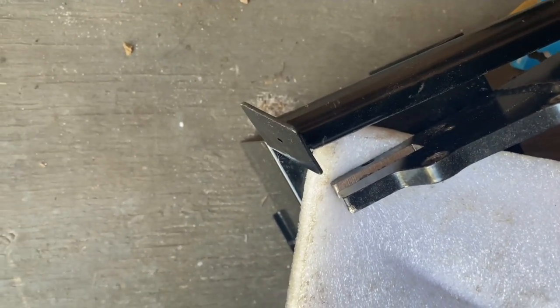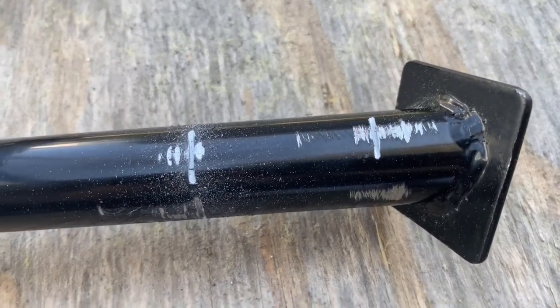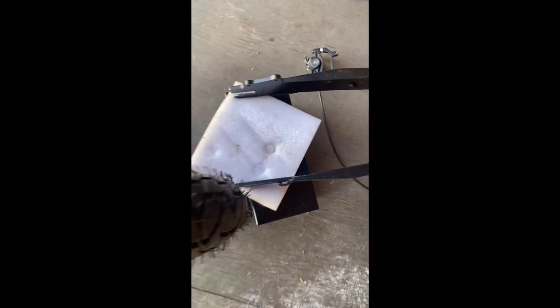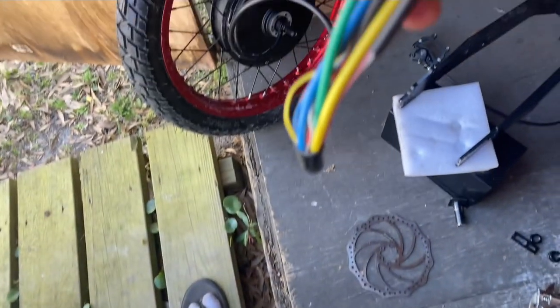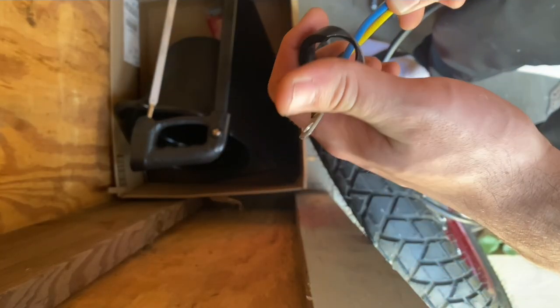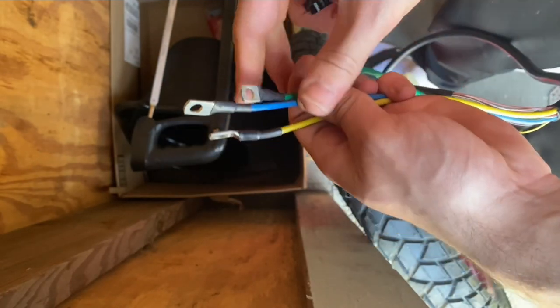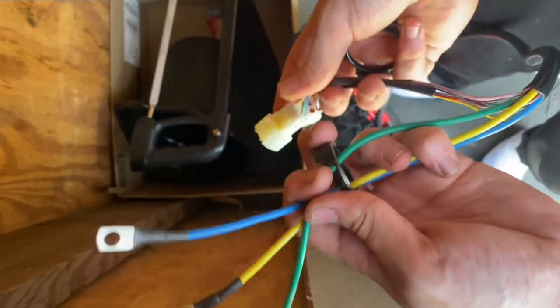You can see that if we don't cut that bottom piece out it's not going to work because it'll contact the motor, so we're cutting about two inches off the bottom with the hacksaw. We're getting ready to put the tire on first because I don't have a mount to hold the bike up while I'm installing the kickstand. While I'm at it I'll go ahead and put these spacers and brakes on first to make it easier.